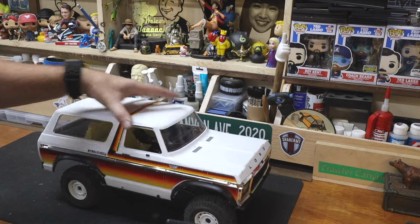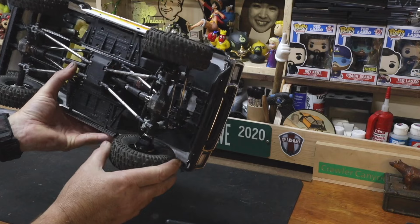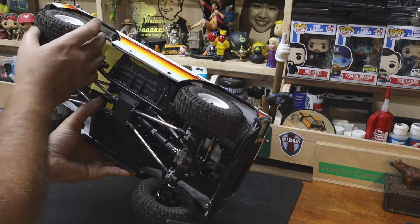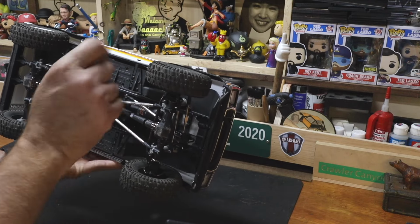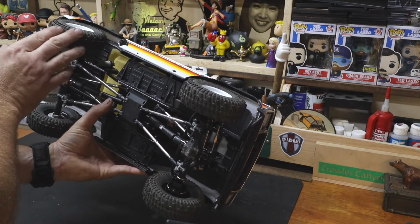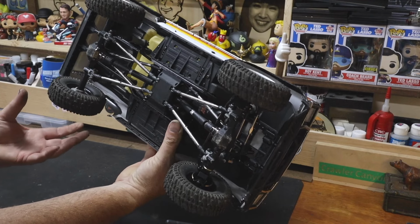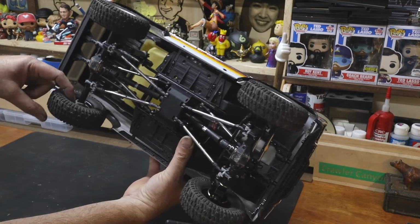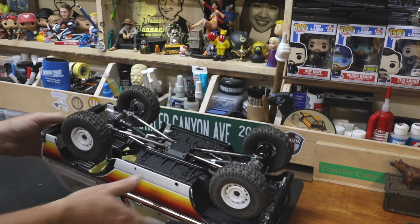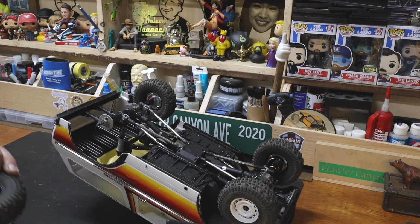Why are we back and forthing on the bench? Because whenever you change to a different wheel with a different offset, you basically want to make sure that the wheel itself isn't bottoming out. Ladies and gentlemen, this is why we do this. Good, okay, bad. So that wheel bottomed out on the hex and is now rubbing against the brake rotor. So if we took that out to test it, we would have a bad day.